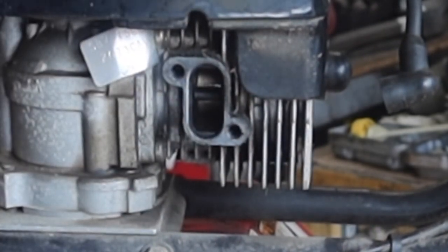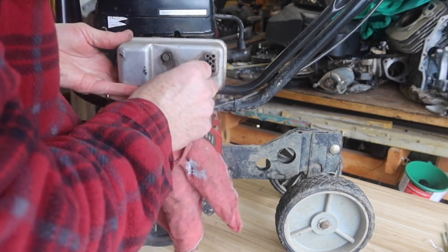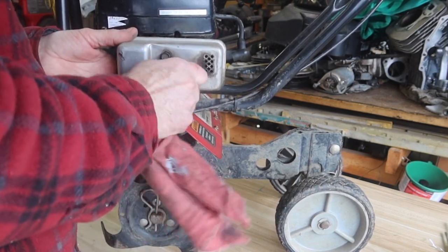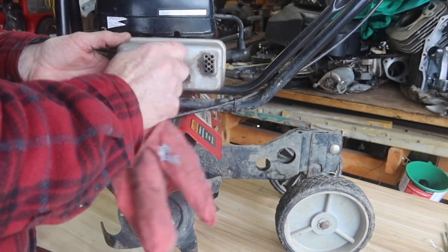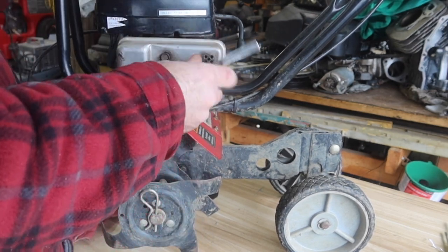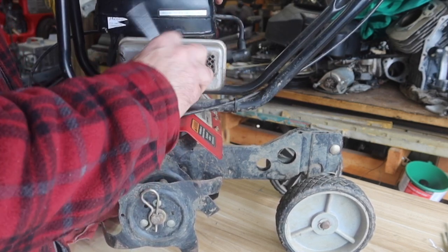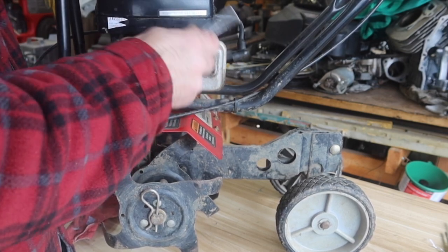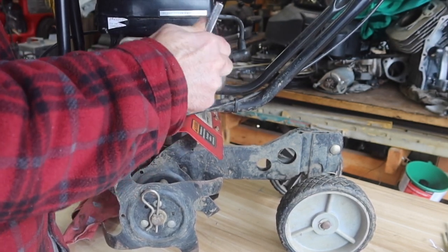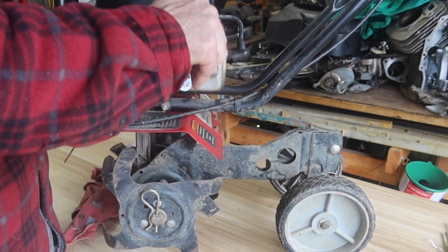It's got a lot of carbon and it's really coked up, but since it runs 24 to 1, it's possible they were doing it right. Feeling a little bit better about it so far. I'm going to put this muffler back on. On a two stroke, I like to check to see if it's scored right off the bat, because what usually happens is I'll start getting really far into it, throwing gaskets and time and effort and parts into it before I realize I never checked to see if the motor is even worth saving. Right now I've got the warm and fuzzies that it's probably worth saving, because on the exhaust side it's not really scored up — meaning nobody straight gassed it or ran it with the wrong mixture.